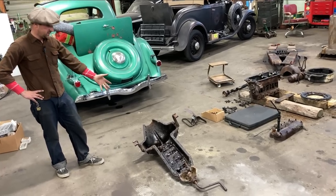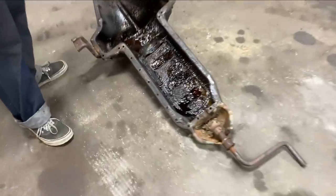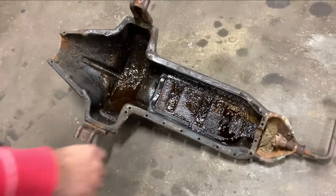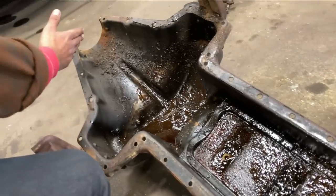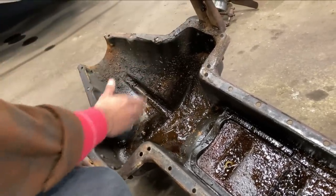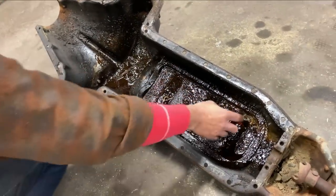The basis of every Model T is the oil pan, which is also the transmission pan — it's a single unit for those who haven't seen it. This is what it looks like. You have your front engine, mid-mount, rear main, and then they call this the fourth main. All your transmission gears are up to this point, engine block from this point, but it's shared oil.